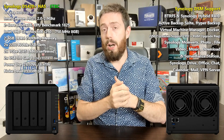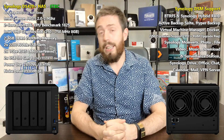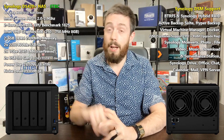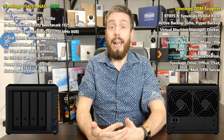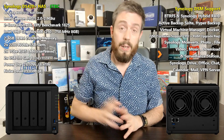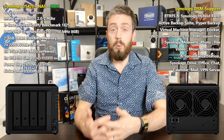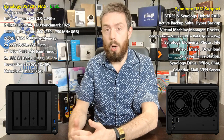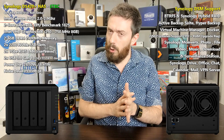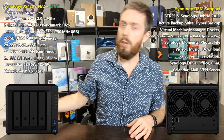This device has a very similar build to the 918 and the 920. It has USB 3 on the front and back, and two LAN ports — so 1 GbE throughput but with link aggregation giving you two GbE or up to 200 MB/s potential. On top of that, the DS420 Plus does have two dedicated NVMe SSD bays for caching, which is hugely advantageous and allows mid-range, affordable NAS buyers to have access to very good potential internal speeds.